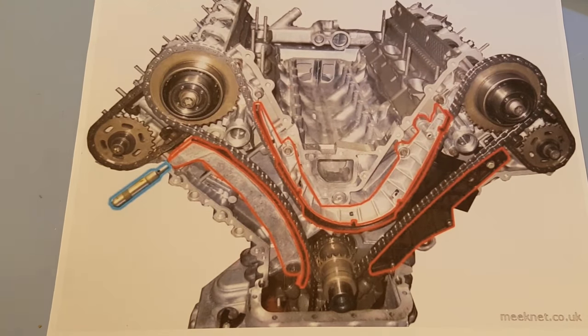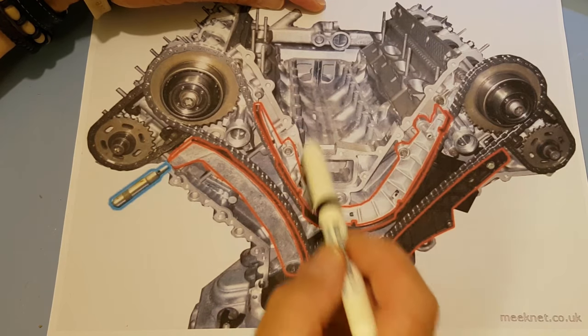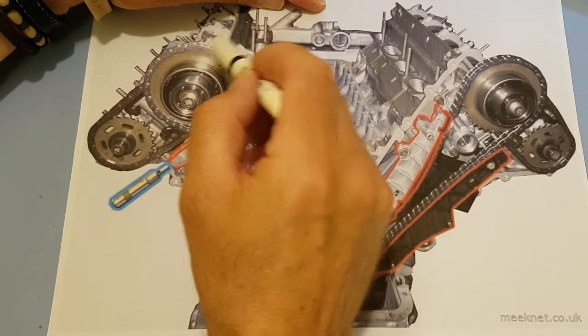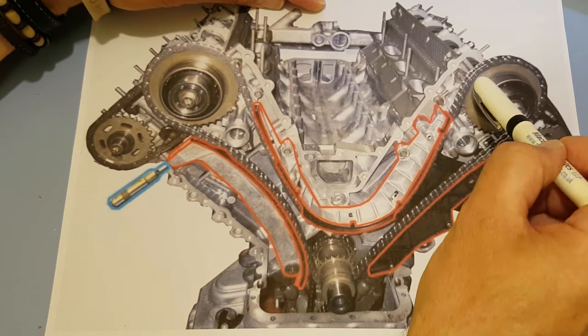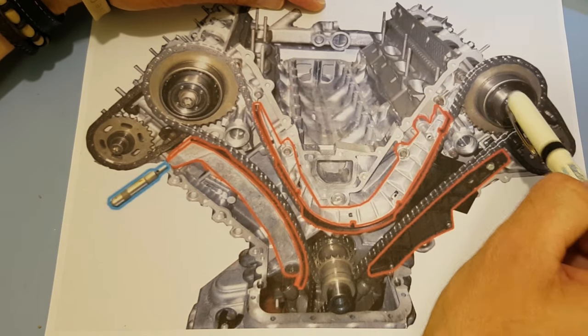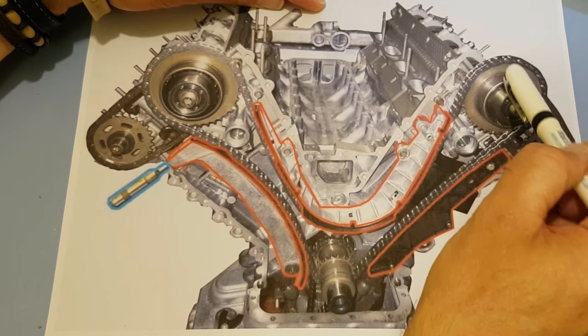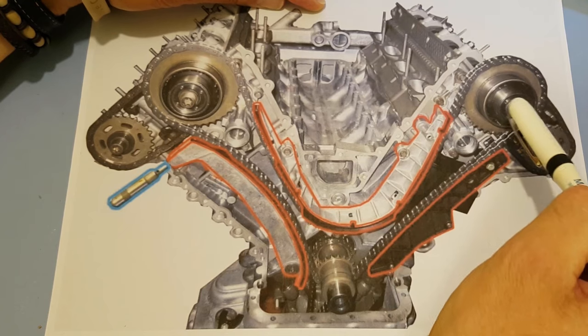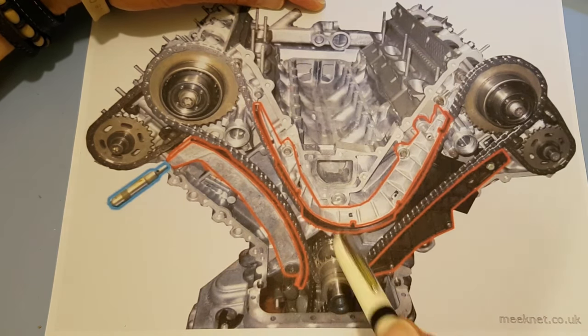Right, well, this is an M62TUB. And you can tell that because it's got the Vanos unit strapped to the inlet manifolds. And of course, the timing between the sprocket and the camshaft isn't fixed. The Vanos units can change the timing, the relationship between the sprocket and the camshaft, by moving the helix gears in and out. But we don't have to worry ourselves about that.